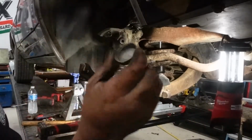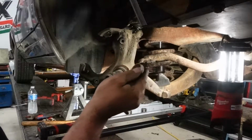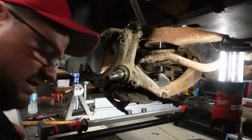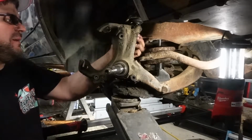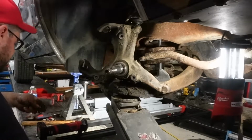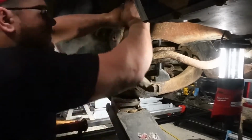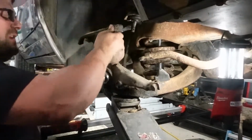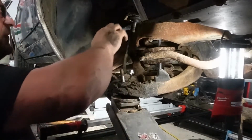This is the freeze plug out of that 307 that we were hunting down. Remember we were missing one? That was one of them that it blew out, obviously. We found it. So we're basically jacking it up, putting some pressure on it. And then I'm going to take the nuts off, right here, the upper and lower ball joint nut. And we're going to lift up the A-frame, the upper A-frame, pull the spindle out, and then pull the spindle off. So now she's pretty much just free.